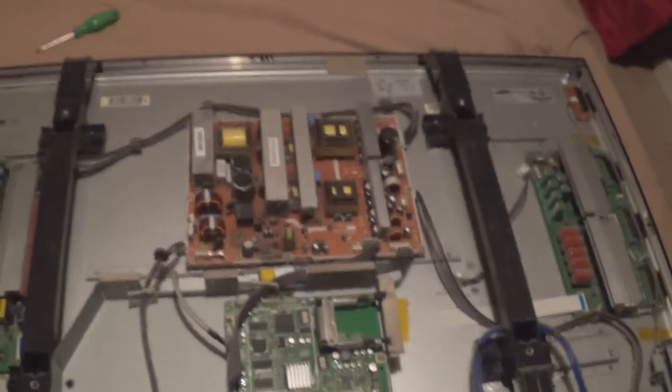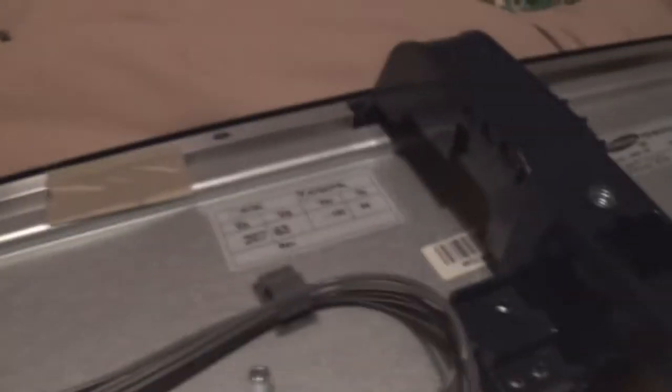I'm going to take those out - there are several screws on them, and I'm going to hoover them before I bother trying to service them. This mark here is not water or where somebody's poured something in the TV. It's actually from where one of the capacitors has blown up on the power supply - I think it's the cap for the 5V standby supply. It's blown up and the electrolyte has squirted onto the back here and dripped down.